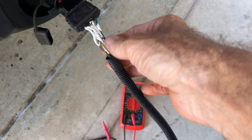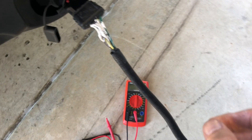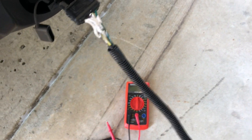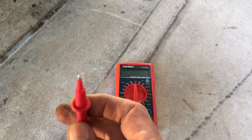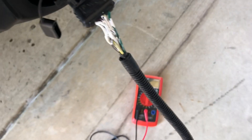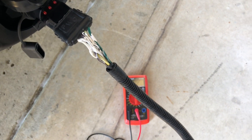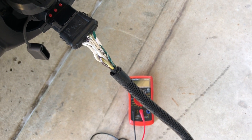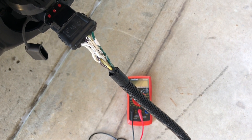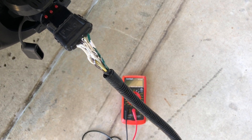I want you to look at this mess with this white — this is actually Flex Seal paint. The reason I did that is because in diagnosing, I used the meter tip to penetrate the insulation on this wire, on the yellow and the green wire. I do not recommend that you do it — I've since read that it opens you up to future problems with corrosion, like an open wound.